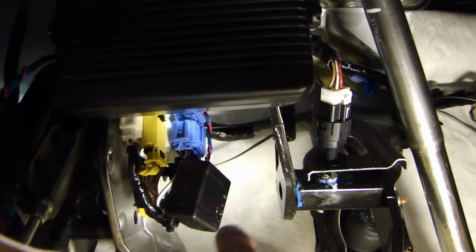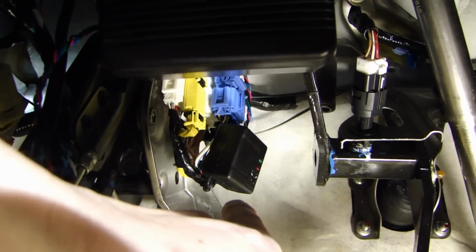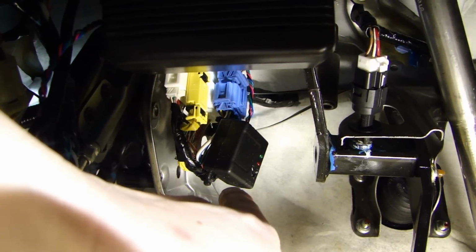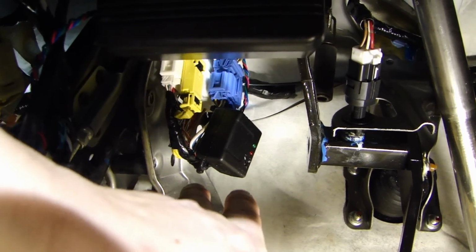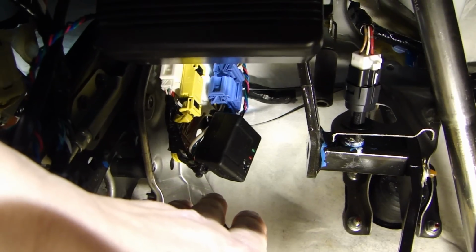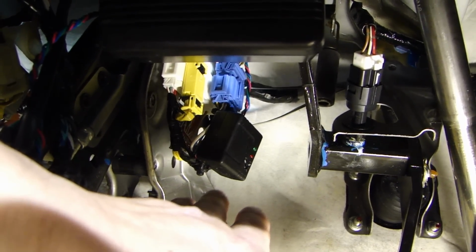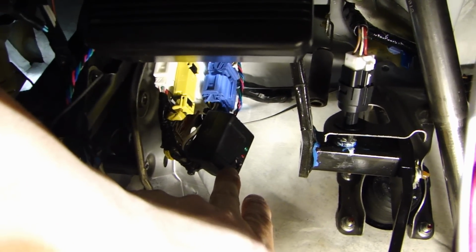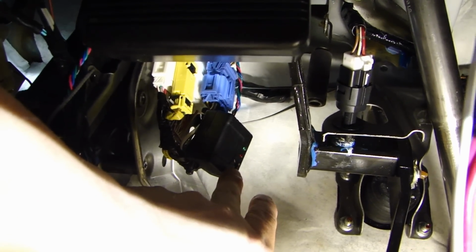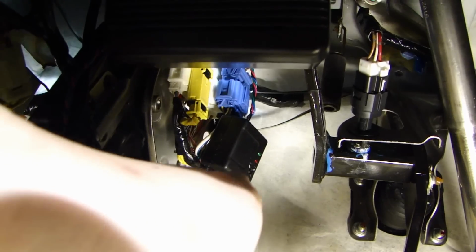I just finished installing the shock sensor, and all I did here was mount the shock sensor onto an existing wire harness using tie wraps. Just tie it up to that area. And also you want to make sure that this is a location where you can access, because you need to set the sensitivity on the adjuster that's on the front of this shock sensor. And then I ran the wire to the top and then back down to the alarm module right here.